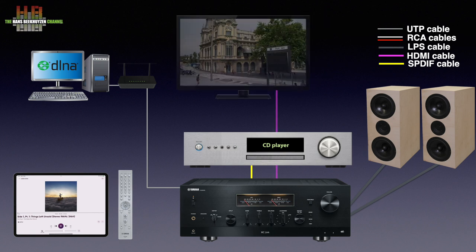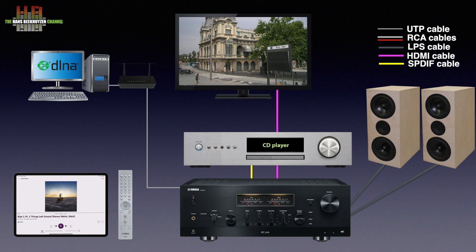It is still possible to connect a CD player over either SPDIF, TOSlink or analog connections. A TV can be connected over HDMI, TOSlink or analog connection. HDMI can be used via the HDMI ARC connection on your TV — ARC stands for Audio Return Channel. The N2000 cannot output video, of course. Other digital and analog sources can be connected too, as we will see later on.